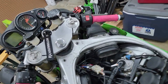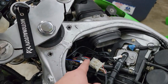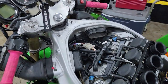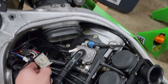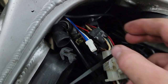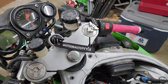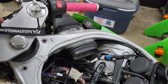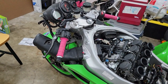I had thought I had this unplugged but after I made sure the speedometer worked I ran it correctly and put the front nose frame back on. For ZX7 people only - I don't know if this is like this on the early model ZX7 but I know for the P model for a fact: the white wire is a constant 12 volt - the instructions will tell you you need a 12 volt, that's where you go. The brown is a 12 volt when the key switch is flipped on. The rest you need to figure out yourself.